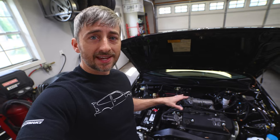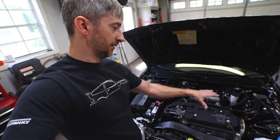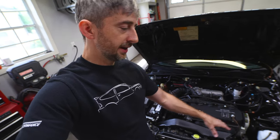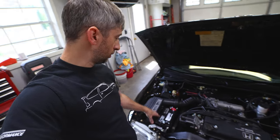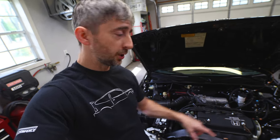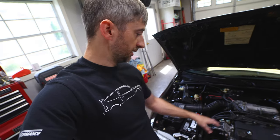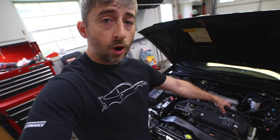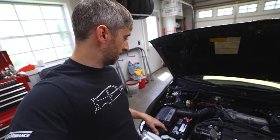All right, this is going to be the second highest cost category of the restore project, the engine bay and miscellaneous engine items. I did replace all the motor mounts, got a new coolant reservoir, had to buy all the new fluids for the vehicle, filters, gaskets I did replace, I did the timing belt, the water pump, I had to buy a new fuel pressure regulator, spark plugs, distributor O-ring, cam seals, what else, the new alternator, new fuel filter, new fuel pump, different items like that.